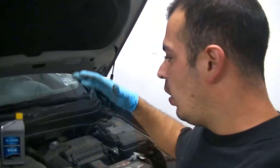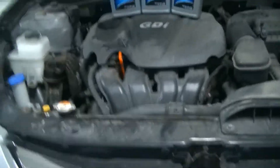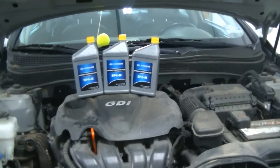We're going to start with doing a drain and fill on this automatic transmission. Now this is a sealed transmission — there is no dipstick, and there is a very specific procedure you're going to need to follow to fill this transmission to the correct level. You are going to need a scan tool in order to read the transmission temperature. If you're going to do it, do it the right way — get a scan tool. I'll leave a link in the description with a discount code for the one we use here on the channel. You should have a little bit more mechanical understanding if you're going to attempt this repair.